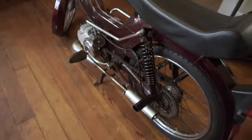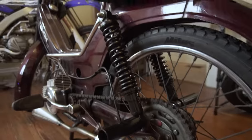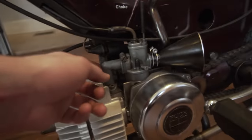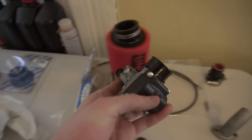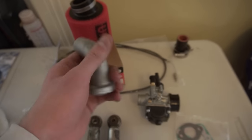We got the new suspension on both sides looking extra crispy, got the stunt pegs on — definitely way more solid than my old setup. Not gonna be bouncing over bumps like a bouncy house and I'll have something sturdy to step on. The next thing we've got to do is this carburetor. This is a 14 millimeter Bing carburetor — Puchs have a Bing stock. We're swapping it for this 19 millimeter Dellorto with a big air filter and a new intake.